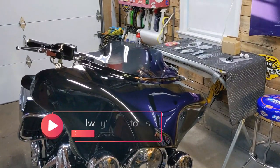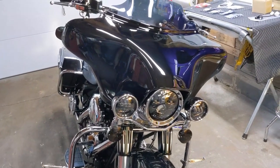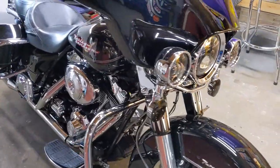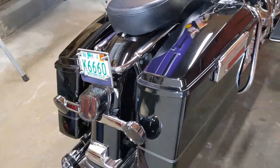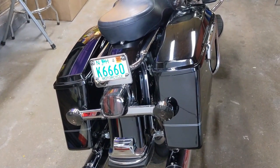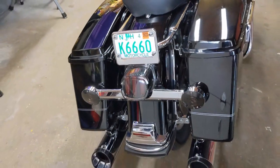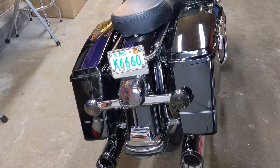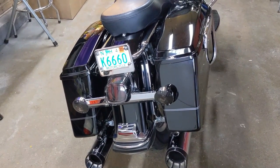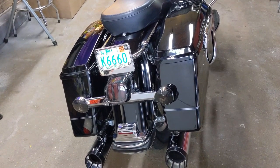Welcome back to the channel. In this video I'm going to do an LED directional conversion on my 2004 Harley Road King. When I got the bike, the first thing I did was get rid of those super ugly yellow and red lenses and changed them out to smoke lenses. I was still running regular bulbs, and when you have that integrated directional and brake light setup and hit the back brakes, those lights glow yellow. I thought about getting red bulbs but all the ones I could find had bad reviews — people say they burn out prematurely and the coating fries off over time.